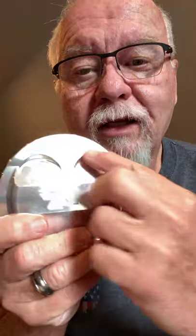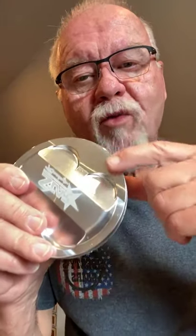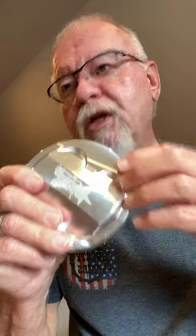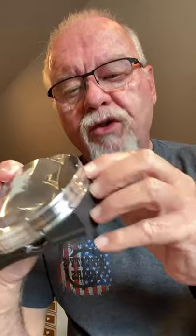They're diamond ground to clearance on the sides. And we use gas ports. And the reason I love these gas ports on the street engines and race engines is because when the cylinder pressure is really big, it blows through these little holes and squirts this ring out hard against the cylinder wall. So your rings are in there going like, we need you to seal, we need you to relax, we need you to seal, we need you to relax.